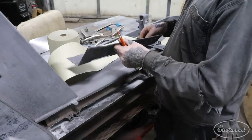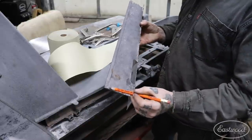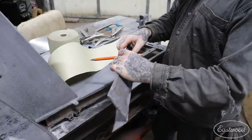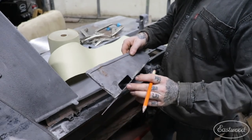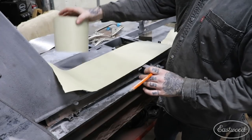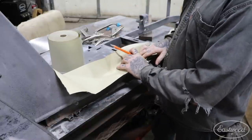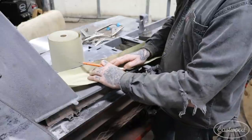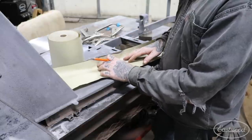We've got a piece cut off here and it is kind of a little bit of a mess, as you can see. What they did for strengthening was actually weld it right along this edge here that was welded to the front, and they basically hemmed an edge over here on the bottom - that's what was giving this a lot of that strength. I was kind of deceived - I thought it would be thicker than 18 gauge, but that hemmed edge really gave it strength, and of course the bend in here helps. To make my pattern I'm just using some masking paper and I found a piece that worked pretty well, folding it in the corners like so.